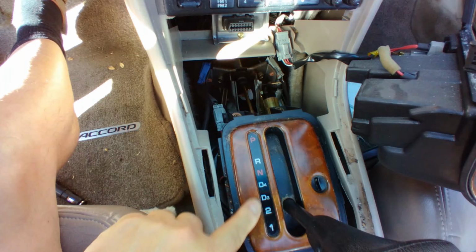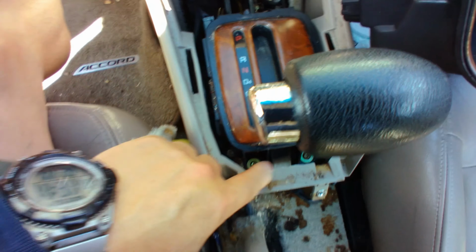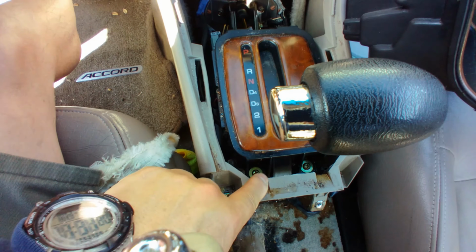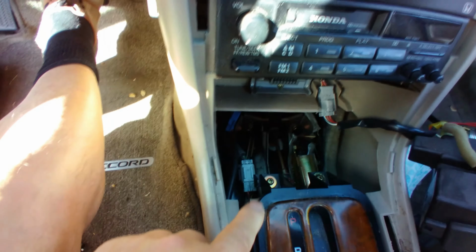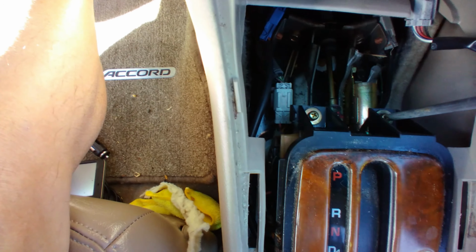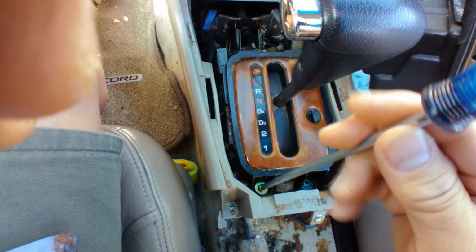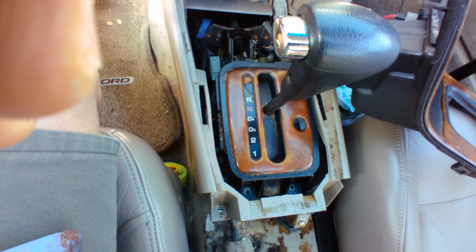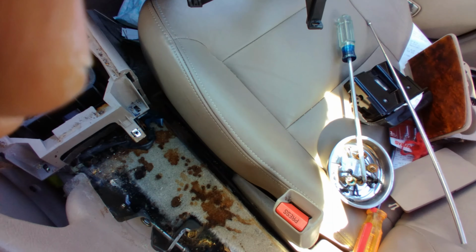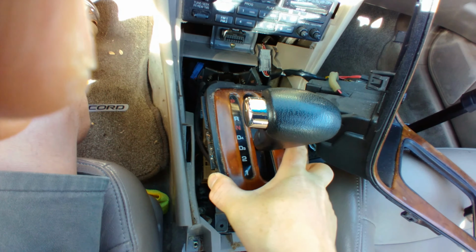Now we have to take out this plate, the gearbox indicator. There's two screws, one here on the rear and one on the front. The screws out, we put on the magnet tray. We'll leave it there. Now we can take the gearbox shift indicator out,